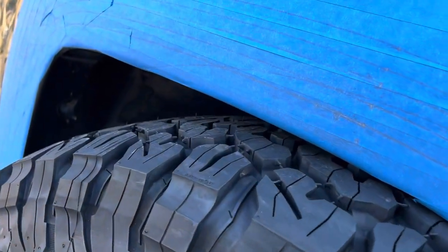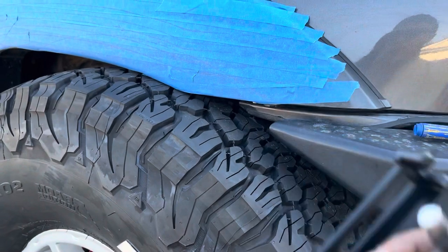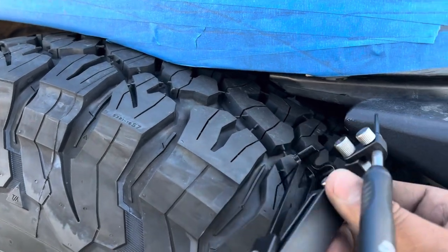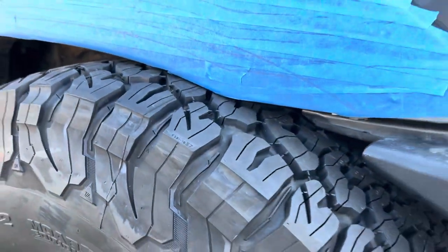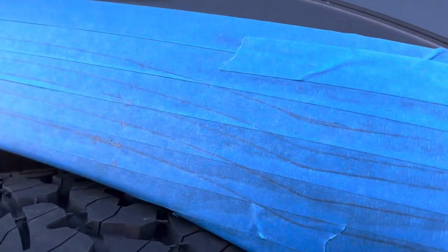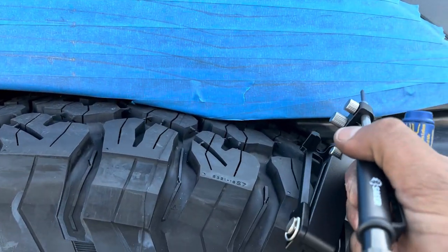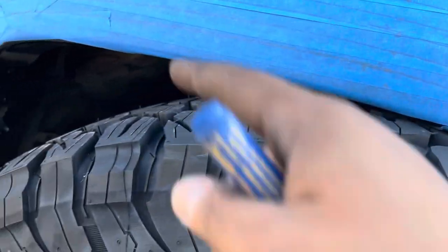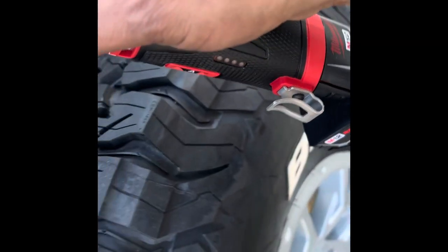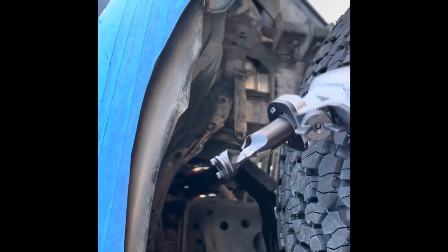Now I got an idea of what fender I'm going to have left — that's going to be full compression on the up. Then I'll turn it — I'm sure the edges are going to want to take some of this out too. For instance right here I got to mark all this and I'm gonna have to scallop that too. I'm about an inch and a half of up travel. Now that I got my marks for my sizes, I'm gonna set this at an inch and a half and ride the tire and cut that out — do two inches since it's an inch and a half, so I'll go about an inch and a half out and cut the back out. Then I'll turn the wheels and see how it looks.